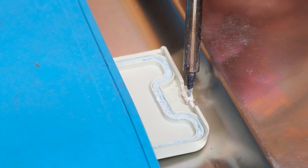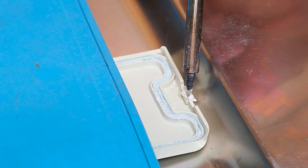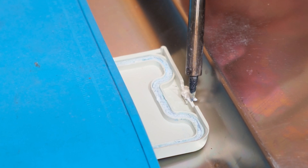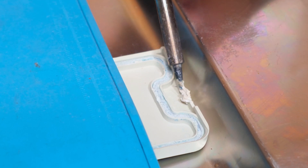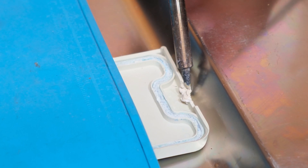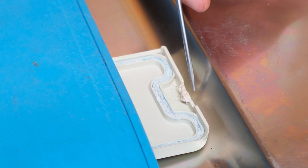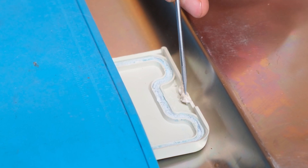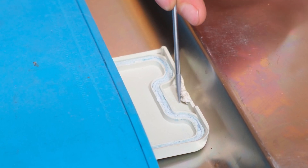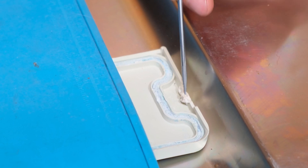I know it's working when the old and new plastic are no longer differentiable. The new plastic was very white while the old plastic is almost beige, and now it has completely changed color. What has happened is the new plastic has totally fused with the old plastic — it stops it from being brittle. It's like one piece now, and notice how resilient it already is.